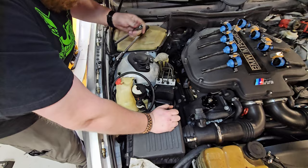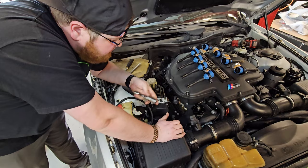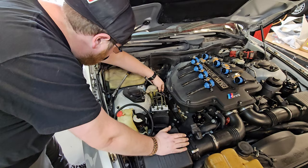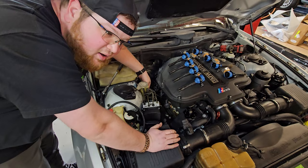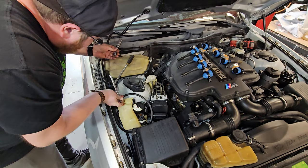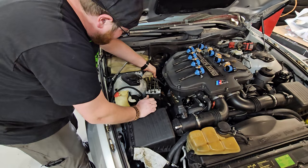It depends on the oil you're using and the gas you're using. The manufacturer is saying you can do that if you're using their oil the entire time. Most people don't — you go to quickie lubes, put a different oil in it, and it fouls plugs quicker. Run cheap gas in it and it's worse the same way. I put Shell in all my cars as far as gas is concerned. I had to stop putting Shell in mine — it seemed like every time I got Shell in the STI it started misfiring. It may have been one of those things where when they do two maps in the ECU and it sees knock and it changes to a lower profile for lower octane fuel — it may have just been tuned better on that map.